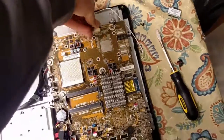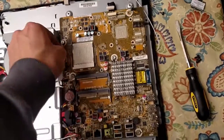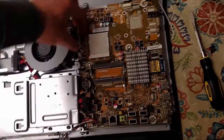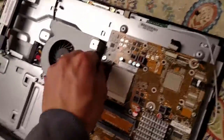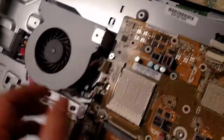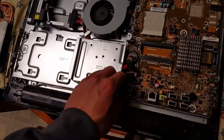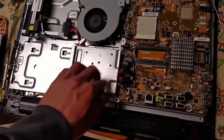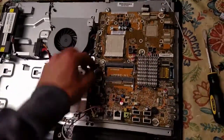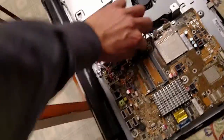When you bake a motherboard, you're going to want to unplug everything you can from it. It's advised that you cover the plastic items that remain on the motherboard in aluminum foil, but I've gotten away with it without doing that, so in this video I'm not going to bother. The only thing I think it would do is make it easier — when you take it out of the oven — to accidentally bend the plastic, or if you accidentally bake it way too hot.